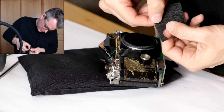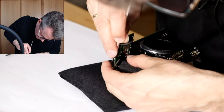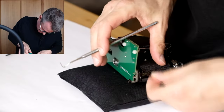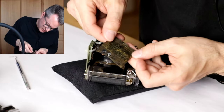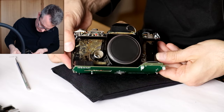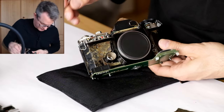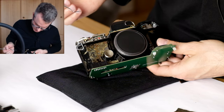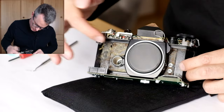I think it already had a small cut here. I got it all fine, and after this was removed the rest was very easy. You see there is not a lot of glue here. The hole I noticed in the other camera that was blocked by a little metal plate is here just open — no metal plate came out below the leatherette. Maybe there never was one, or maybe this was already lost by someone who opened the camera before. I am also not sure if all the glue here is original. Now that the leatherette is off we should be able to remove the front cover.